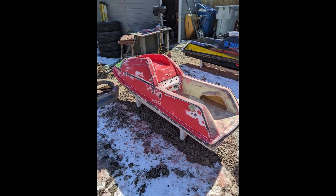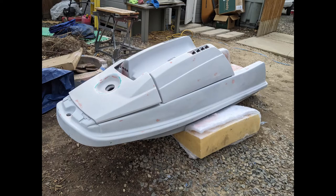And that's pretty much it. You can start out with 120 grit to get all the really bad spots out. You can then switch to 400 as the last thing that you need. You don't need to go anything higher than that because the primer will take care of that. So just have the 320 or 400 as your final sanding efforts, but definitely start with 120 to get rid of the bulk of all the imperfections.